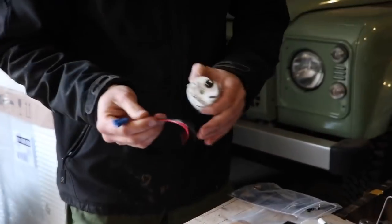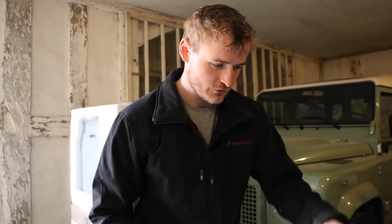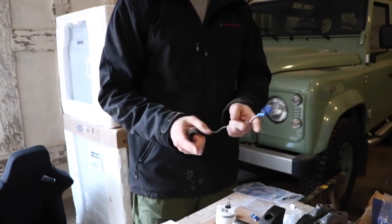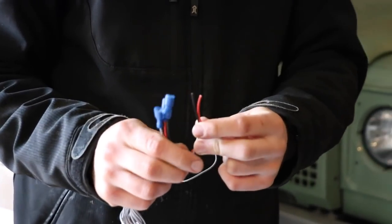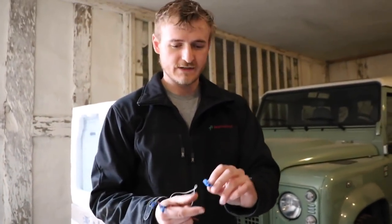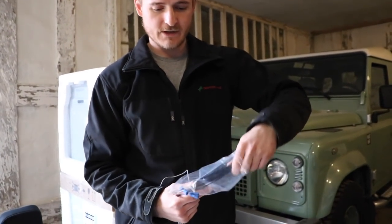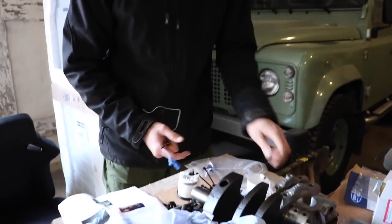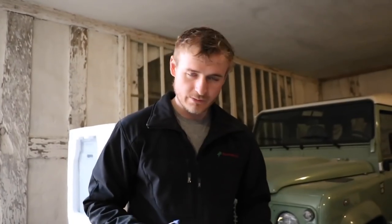With the kit you get wires for jumping the light circuit — two front ones connect together, and the other two go to a light source behind the dash to make the bulb light up. There's also a longer remote wire that goes into a pin in the black plug on the ECU, and another wire to supply power to the counter itself so the needle can move. To connect these you get small inline connectors to jump from one wire to another, plus plenty of zip ties to keep everything neat, and a locking ring for behind the gauge.